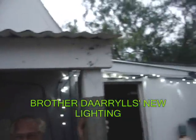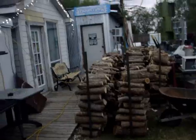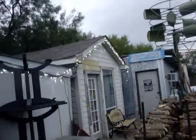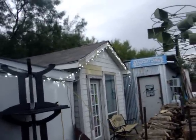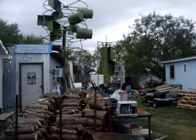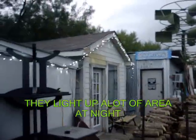It gets dark here at night — it's a good-sized area, all this wood and a narrow walkway. Somebody leaves one thing here, somebody can get hurt. We took ten dollars and bought a hundred-LED strand, which isn't using very much wattage at all — about seven watts tops. Plug it in and you can just about leave this plugged in 24/7. When it's on I can see all this and walk back there — it's almost like a full moon. Very efficient, very cost-worthy.